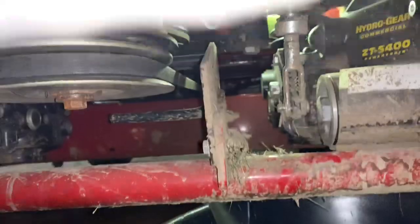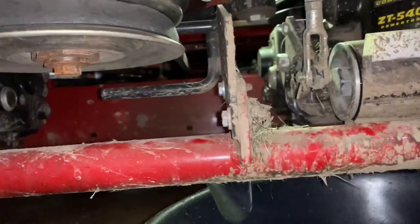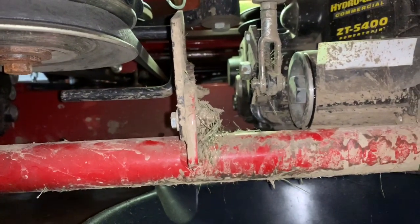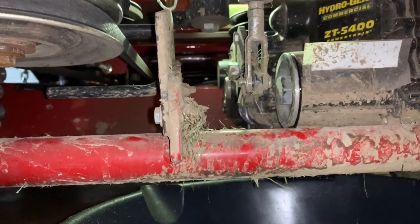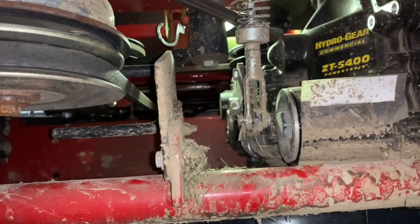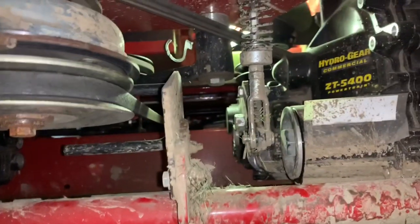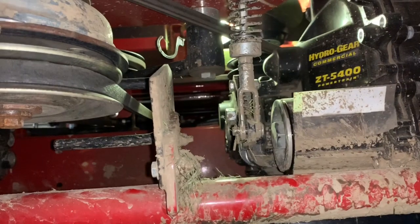I got that undone. I can't do this with both hands — one's on the camera and one's in there. I got it loosened up. As you can see, the gap's there — now I'm just going to twist that off and the oil is going to leak out into the pan right here. I can see there's a lot of dirt here, so before I do that I'm going to tighten it back up. I want to do a better job of cleaning — it's kind of muddy under here and I really don't want any mud getting in while I'm working. I wanted to show you how using this gun with the swivel made it possible, because trying to get in there with a regular socket set is very difficult.